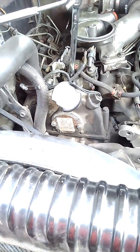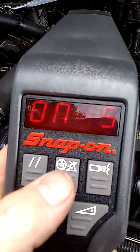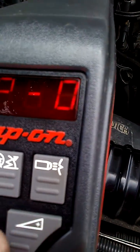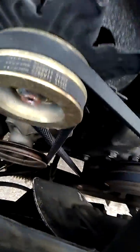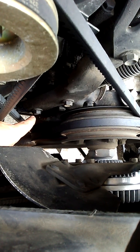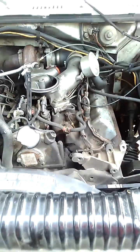To find out your current timing, the motor actually has to be running to get a timing reading. On mine, I hit the advance button — it starts at zero — and I can adjust up or down to what I want my timing to be, then flash the light. You have a mark on your crank pulley itself, and right above the crank pulley there's another mark where they did the old luminosity probe method. When those two marks are lined up while you're flashing with the light, and that coincides with the timing reading on your screen — basically I set this to seven at 2,000 RPMs at normal operating temp, flash it, and those lines are lined up perfectly — that's your current timing.